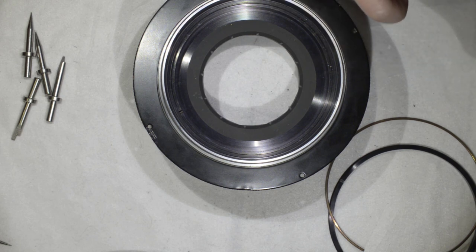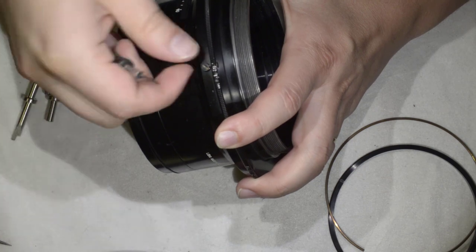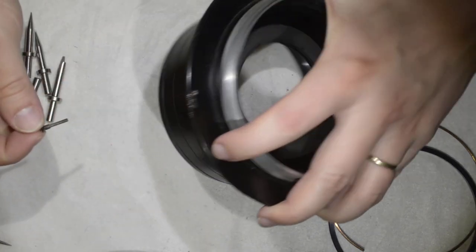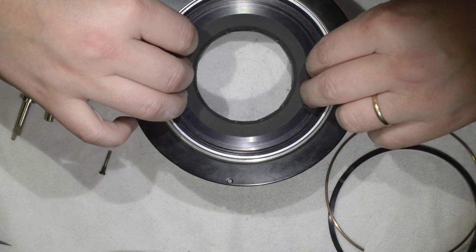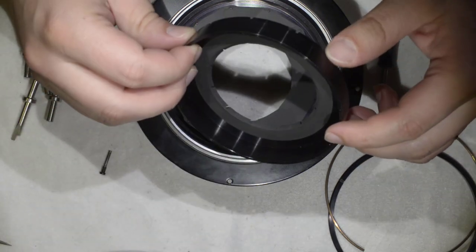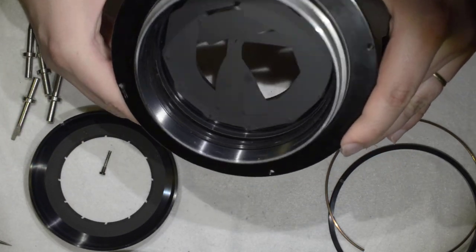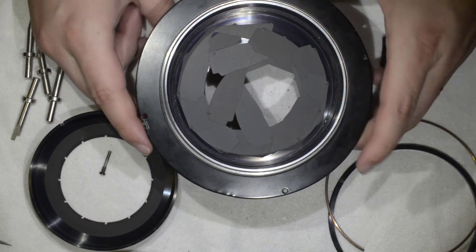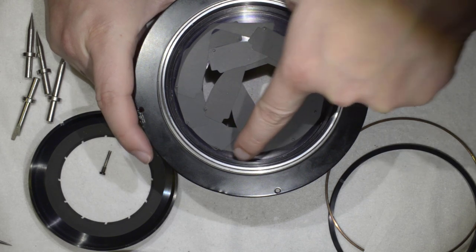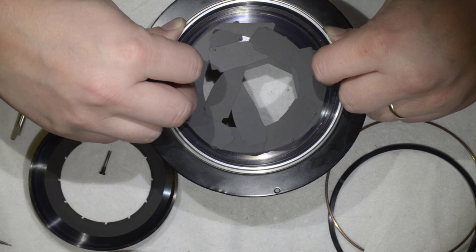and then once you have that pin, just let me get a screwdriver. So you get this pin here, and then you're able to remove this element here, which is the guiding for the aperture blades, and then here we have the aperture blades. Oh, bad idea. Okay, anyway, I need to remove them, and then I am able to see there's a slot here behind, and then I can see that this thing is able to move,